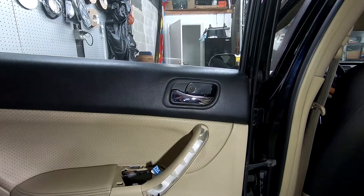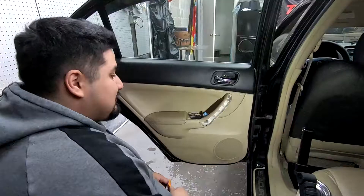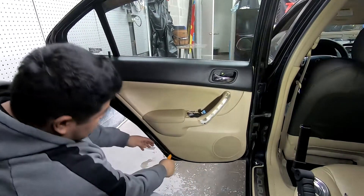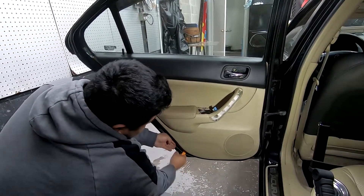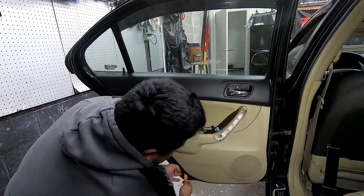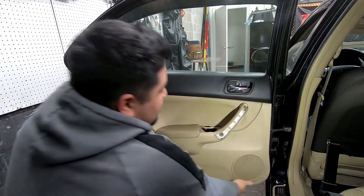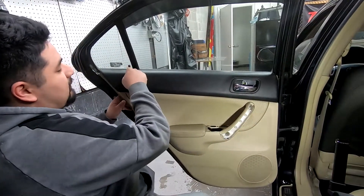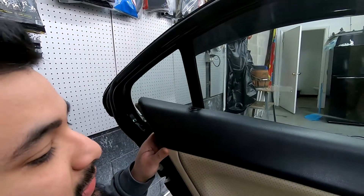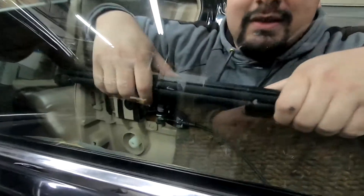This panel is very easy to come off. The last thing you need to be worried about is the door latch cable. Now that we've got all our screws out, we're going to begin popping from underneath — stick your pry tool down here and start pulling off. The bottom is really the hardest part. Then you're going to lift up and over this lip right here and pull towards you.